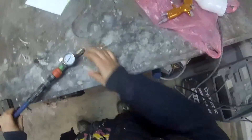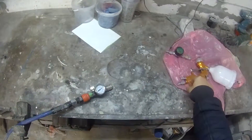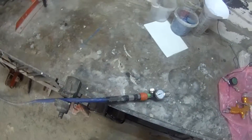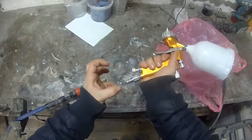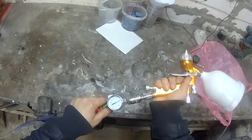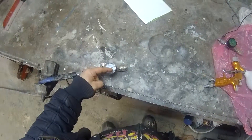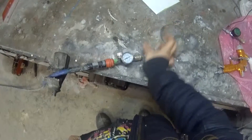Another thing you can check with dynamic air pressure: I don't use a water separator on the gun, but I know lots of painters do. Sometimes the water trap gets clogged and doesn't provide sufficient air and pressure to the gun. To check it, just put the air trap under the gun, connect it to the air regulator, and when you push the trigger, the pressure gauge arrow drops — but not much.